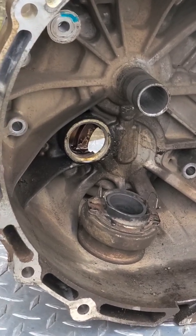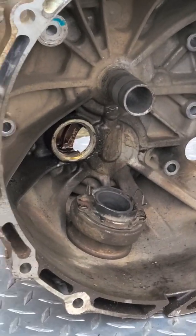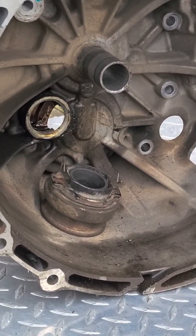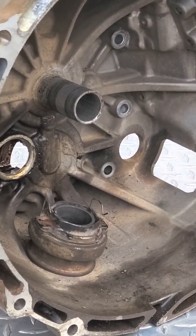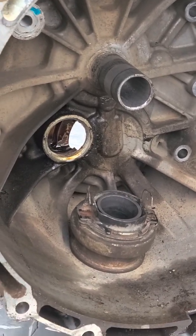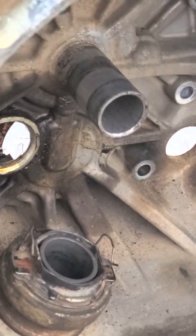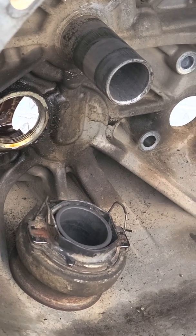To really refurbish everything you touch with new parts — U-joints and all that — expect $3,000 in parts, $4,000 or whatever with labor. Or it might be cheaper if you go with the steel sleeve or the hydraulic kit from URD. Maybe 160,000 miles — the noise was lasting for 30,000 — you have some time. Do with it what you will. But this is what caused all of it. It's kind of a flaw by design. Hope this helps somebody.